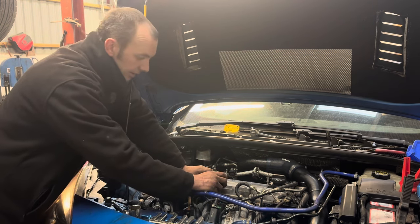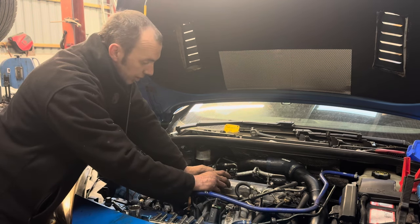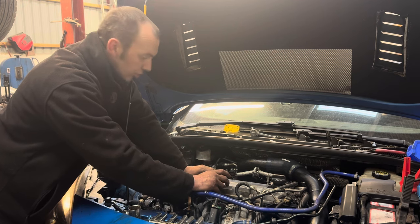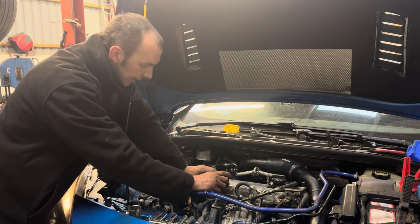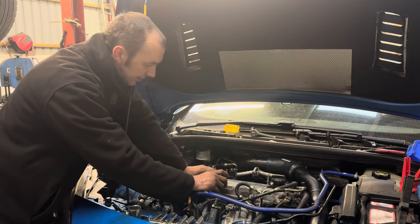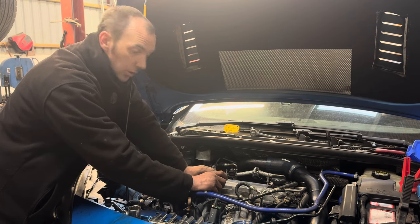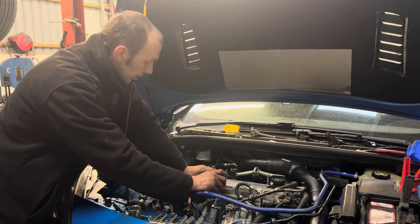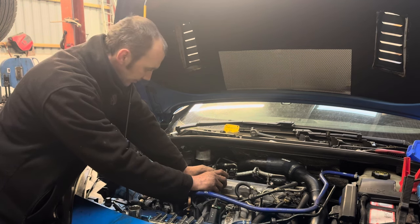Right, okay. We had 20 PSI before, we're at 30 PSI now, so it's had a 10 PSI increase on that cylinder. 30 is still nowhere near perfect. However, if we manage to get up by 10 PSI on a down cylinder, the likelihood is that on cylinders 3, 4 and 2, the pressure is also going to be back up to where it needs to be.